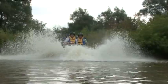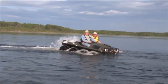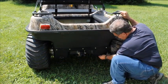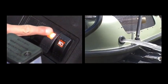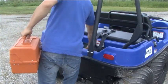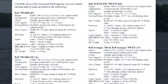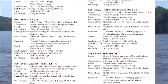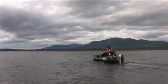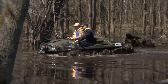The Argo is an amphibious vehicle capable of crossing streams and small lakes. Before heading to the open waters, always inspect your vehicle for properly installed and closed drain plugs, proper operation of the bilge pump, punctures in the lower body, and cargo placed deep in the lower body. Read and understand your Argo's Operator's Manual. Follow the weight restrictions because the maximum payload in the vehicle is decreased in water. Familiarize yourself and comply with local boating rules and regulations. For safe operation in the water, always wear appropriate personal flotation devices.